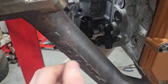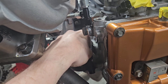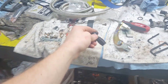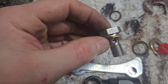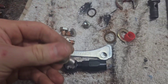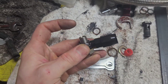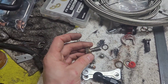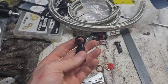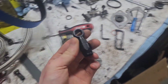I need to make this line but I just need the actual right banjo bolt. This is an M14x1.25 fitting, and I ordered the wrong one — I ordered the M14x1.5 thread instead of 1.25, so it just doesn't work. Earl's fittings are really nice; this one is actually made for a fuel system on a carburetor but it'll work here. Got the correct one coming from Summit Racing, then we can make these lines.